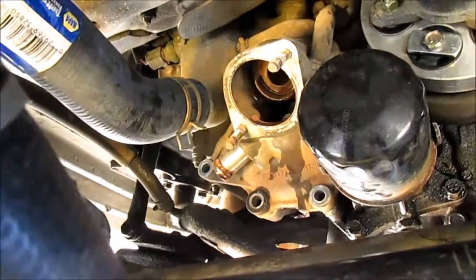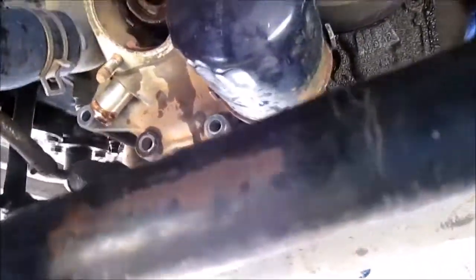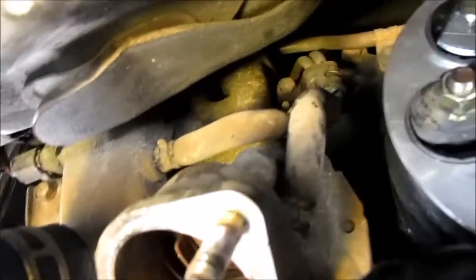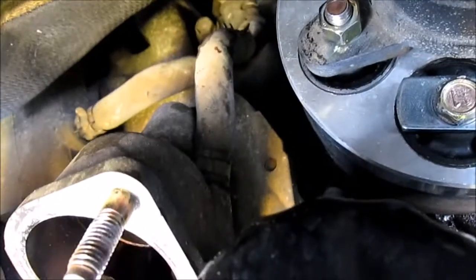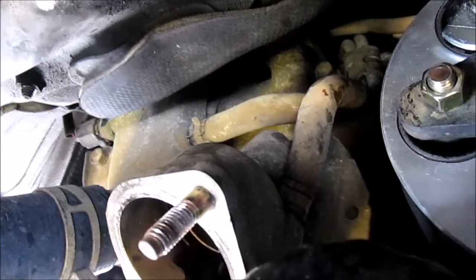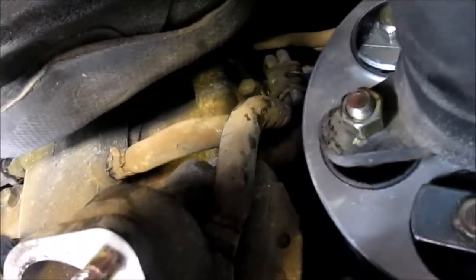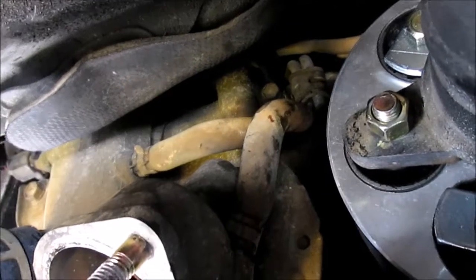So we've got the heater hose off, the lower radiator hose and the thermostat housing off — you can see that's where the thermostat goes. I've gotten all the bolts out except for one that resides behind this little hose going into the top of the housing. I'm going to try to move that clamp and get that hose off without breaking it. You can see there's a second hose — it comes down a couple of little pipes up there, some kind of bypass hoses.